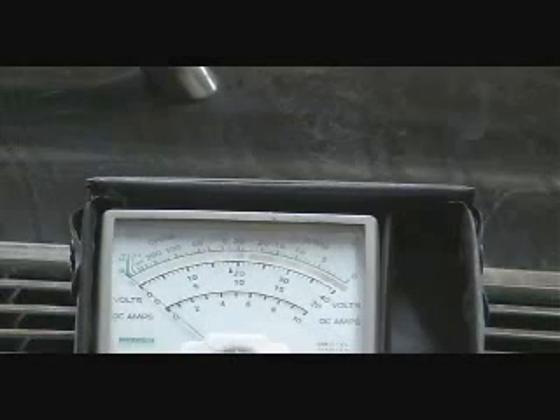The first test I'm going to do is test the trigger. The trigger should supply roughly 10 volts on this engine. You may see as low as 3 volts on other engines, but as long as we get some voltage out of the trigger, we can confirm that it does indeed work. We do indeed see 10 volts — the trigger works.